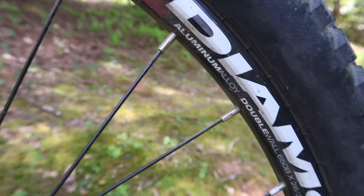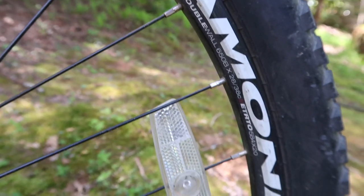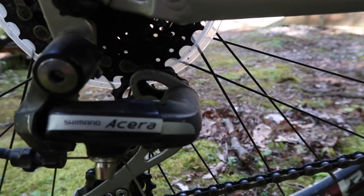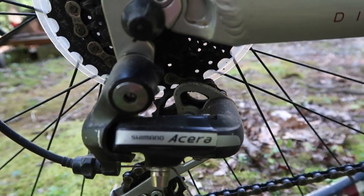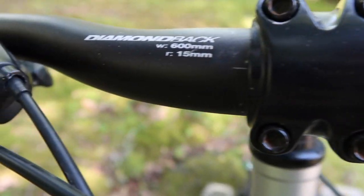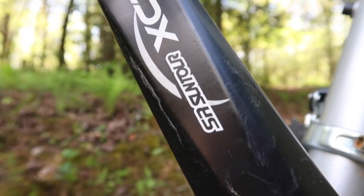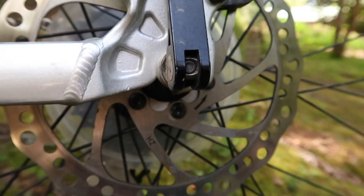Starting out, this bike has 27.5-inch tires, which is what I run. It also runs a 3x8 Shimano gearing. The one thing I don't like about this bike is having the third chainring — I feel like there's a lot more maintenance with it. For someone just getting into mountain biking you might want the lowest gear possible, but I really prefer a 2x8, which is what I ride currently. The 3x8 feels like a little overkill, but she has it if she needs it. It also has alloy triple cranks and disc brakes.